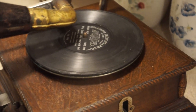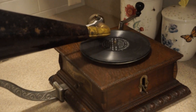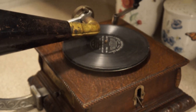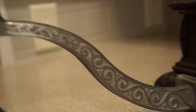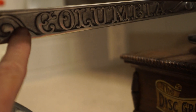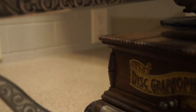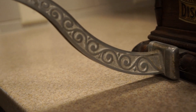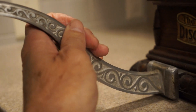Victor was also introducing the rear-mount horns. This is a front mount. The rear mount put the weight of the horn and the reproducer on the case versus on the record. Now, one thing you want to be careful with is this support arm and this traveling arm here — people call this a tone arm, but it is not. It's a traveling arm; it travels with the horn — no tone or sound goes through this. You have to be careful because there are a lot of reproductions. These are cast aluminum, and the reason is they break, and people have a tendency to pick up the machine by this arm, which will break it.